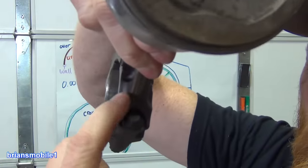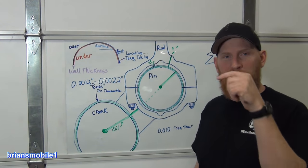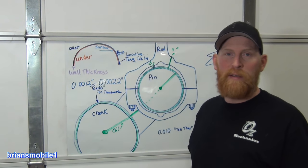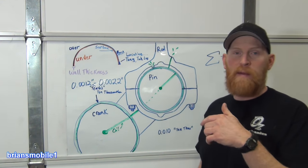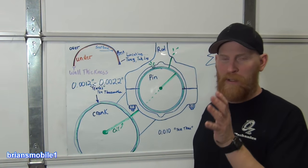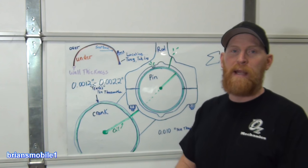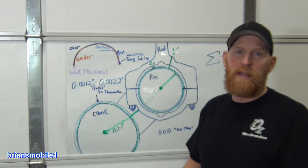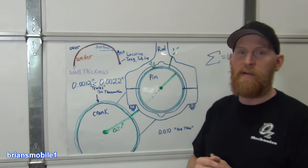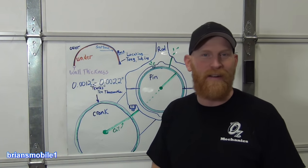Typically the oil will go out the side of the rod bearing — you can see there's a channel here to help facilitate it on this side, and when you rotate it there's one on the other side. There's a whole bunch of stuff I'd love to tell you about windage, but there are two videos linked in the description. One is an article by Greg Acosta, and then David Freiberg from Motor Trend did a video with a test dyno engine going over things that cause parasitic draw to the crank and aeration of oil. When you aerate oil it can't do the two main things oil is supposed to do: lubricate and take heat away.